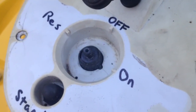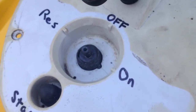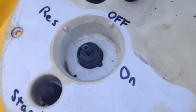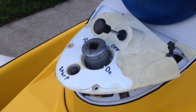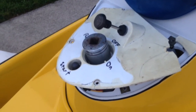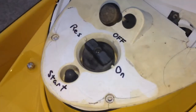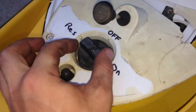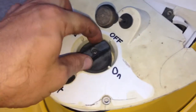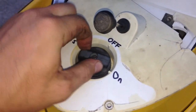Next, feed the fuel selector through and make sure that the notch lines up, then install the nut that goes on there. The socket that fits on that big nut is an inch and three-sixteenths. Then you can install your screw in the center, but before you do that, make sure that the selector will go to all three positions. If it will go to all three, then you have it installed properly.